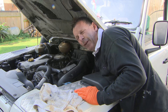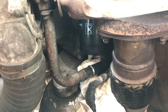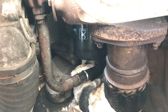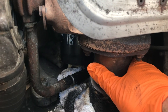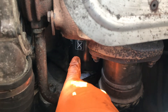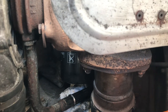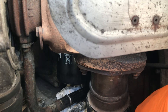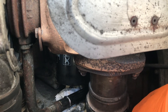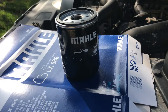I'm just going to loosen it off and run the engine up to warm the oil. So I've run the engine up, just warmed it up — it's not hot hot, just warm — and I'm going to pop the filter off. The exhaust manifold's warm but it's not too bad. There's the filter. I've just put some old towel and rags underneath because it's going to leak. I've seen people take these off cold, but I've run it up warm. Whatever you do you're going to get oil coming out somewhere. I've got the other oil filter just there waiting to go in.